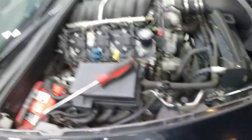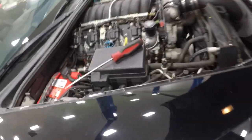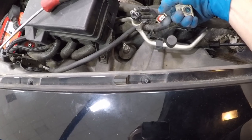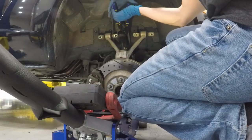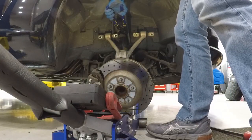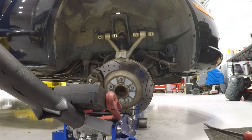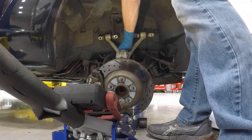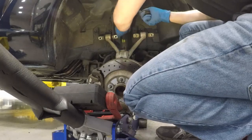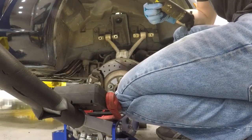There's the sensor for the MagneRide system - the position sensor. I'll get that unplugged, just need to get that nut off and then the shock will come out. I'll use pliers on that step - not supposed to do this but they're worn down anyway. That little bit of holding was enough to let it loose. And that's that - one blown-out shock. Garbage.